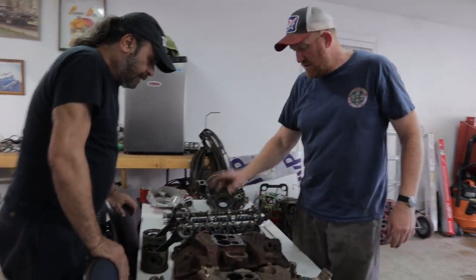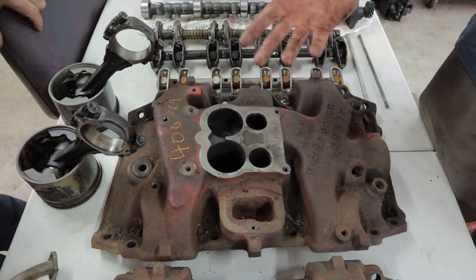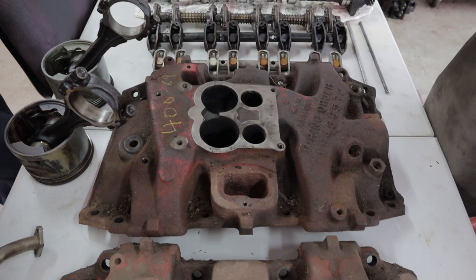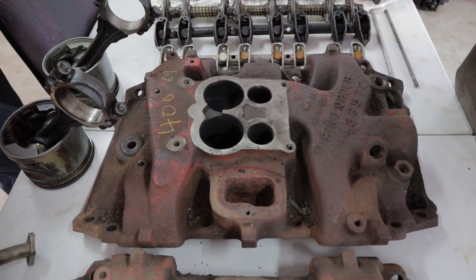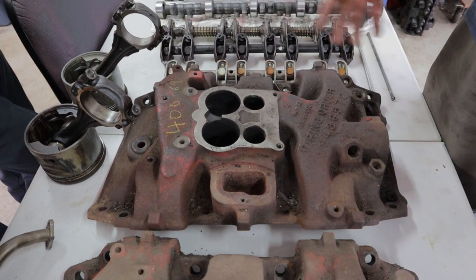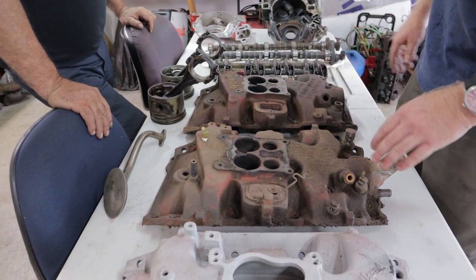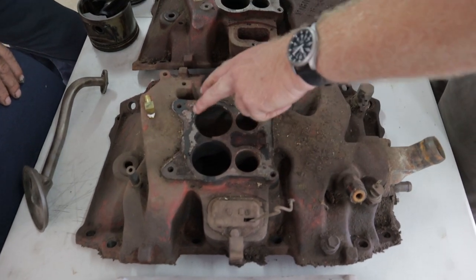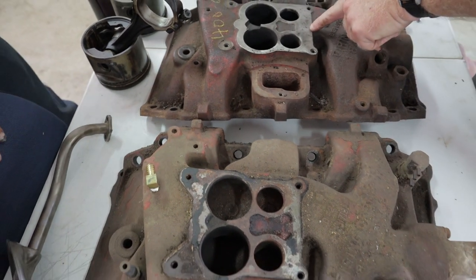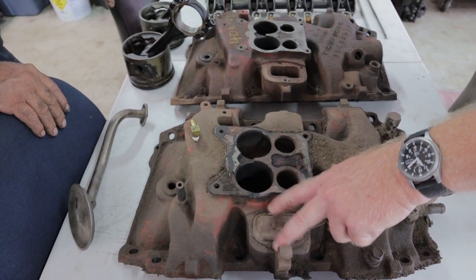Intake manifolds: here's the earliest model, '67 through '69. I actually have a '67 but they all look the same and they're not bad — this thing probably weighs 65 pounds. Most guys reuse these intake manifolds; there's not much difference between them until you get to the later ones with EGR castings, air injection, and EGR ports — I pretty much just give those away. This is a '70 — the only difference you can see is the carburetor pad is more like the standard Quadrajet pad people are used to seeing. The ports are all pretty much the same across the different years.